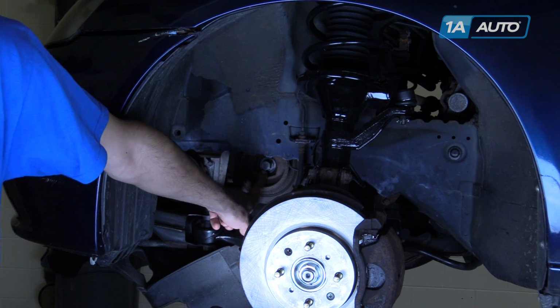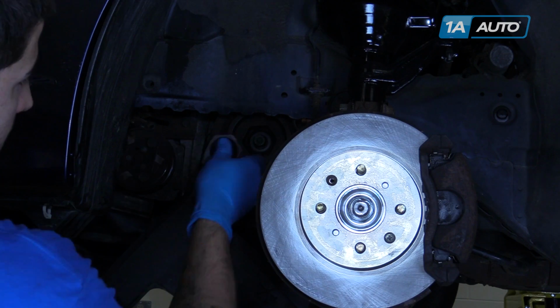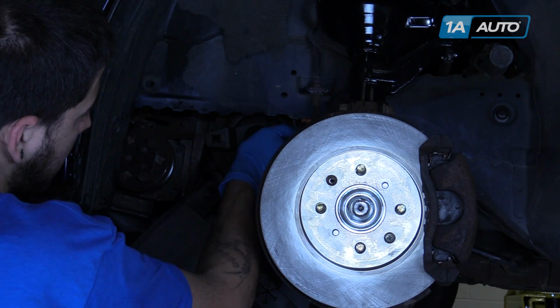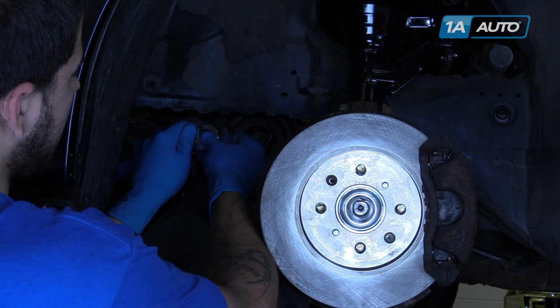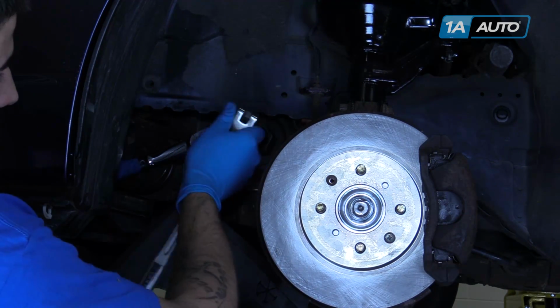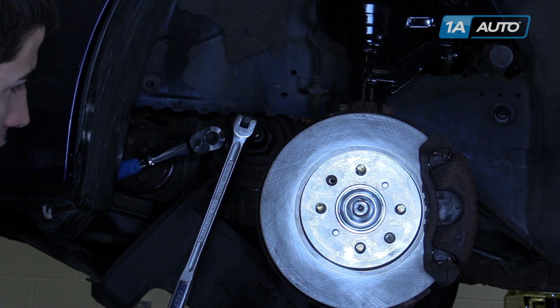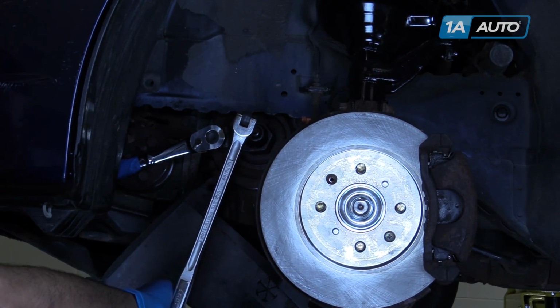To remove the 19 millimeter bolt on the crank pulley, you'll need the special holding tool from Honda, which sits into this hex, a strap wrench to keep the pulley from turning, an extension and a breaker bar. Get onto the 19 millimeter bolt in the center of the pulley. And these tend to have a lot of torque on them. They're very stubborn.